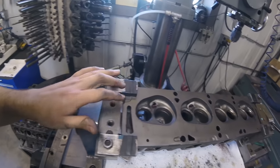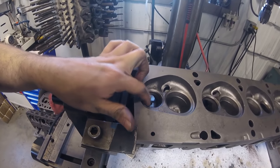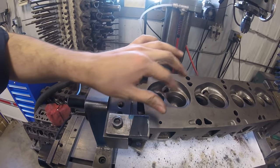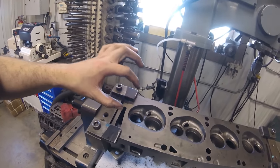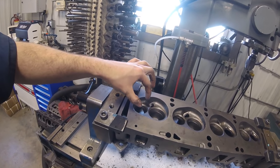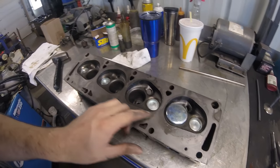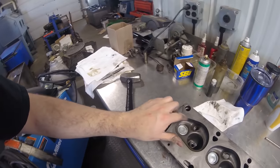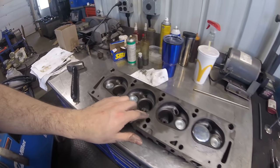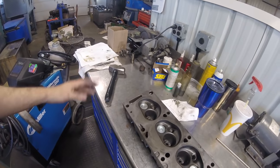On this head leveled up on the machine ready to cut the counter bores, you'll see that the exhaust seats are just the original casting from the factory - there's no seat actually installed. We're going to be putting in both exhaust and intake seats. On this other head they already have seats from a previous valve job, so I'm going to use the welder to weld around the circumference of those seats so I can pop them out and install our new seats from scratch.